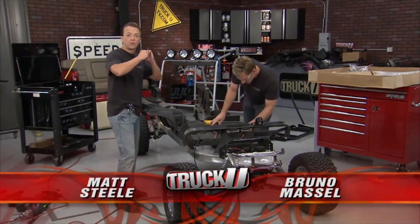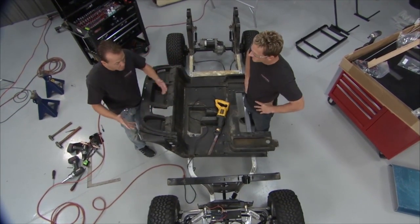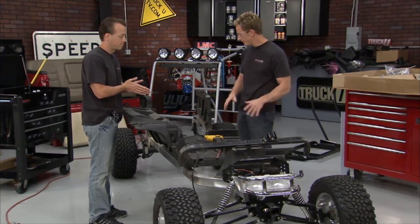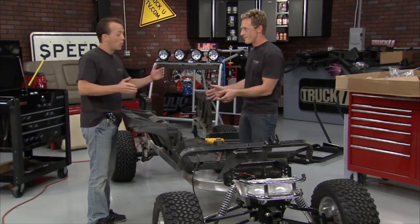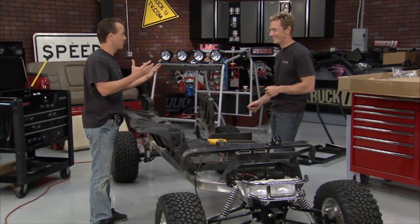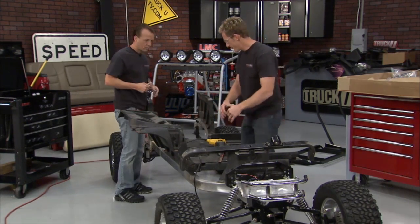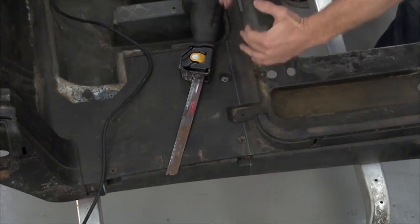Welcome back to Truck U. Today, what we're doing is stretching out this golf cart — this award-winning golf cart, if you will. The frame's cut, the extensions are put in place, and that's coming along nicely. We got this Precedent extension kit from our buddies up at Club Car. They've got them ready to go and it's nice and easy. Like we said before, you can do all of this without any welding, but you do have to do a little cutting and a little drilling. The chassis is all done, so you can put all your entourage on this thing. We're going to have four seats going forward — a bench in the back with two seats facing that way, so that's six people. The entourage is growing every day. The next step is to cut the underbody — we'll still utilize the whole front part and the back part with all the same mounting locations; it'll just be an extension to fill in the middle, separating through the middle so all our mounting locations will still work.